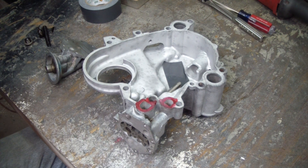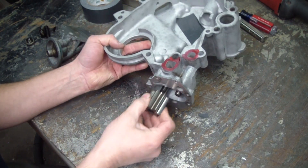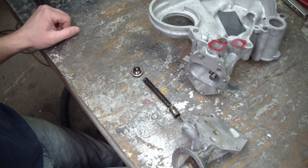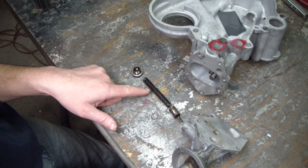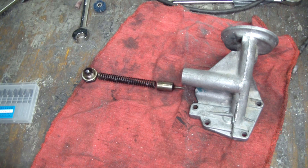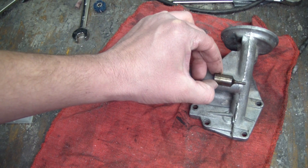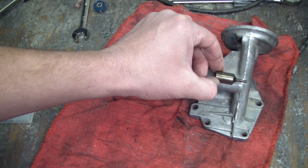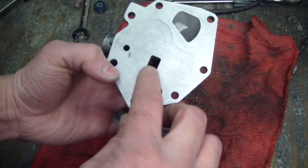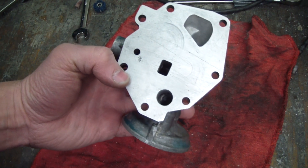So I'm going to do anything I can to help out the situation here. I'm going to pull the gears out and get a new gear set. Inside the oil filter housing is your pressure relief valve and the spring behind it — that basically sets your oil pressure. This valve sticks in this tube here with the spring behind it. When the pressure is high enough it pushes the valve back and then the oil can flow into this passage, and it comes out this hole under the low pressure side of the pump gears and gets recirculated.